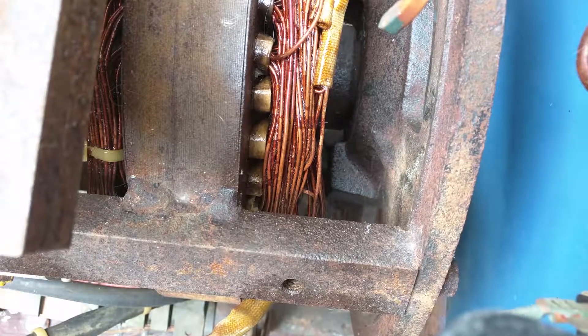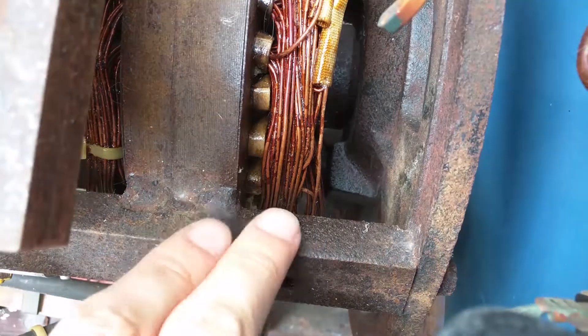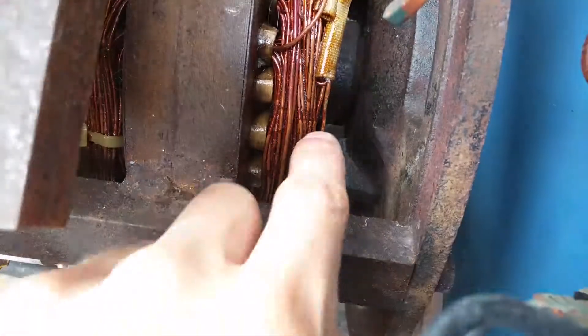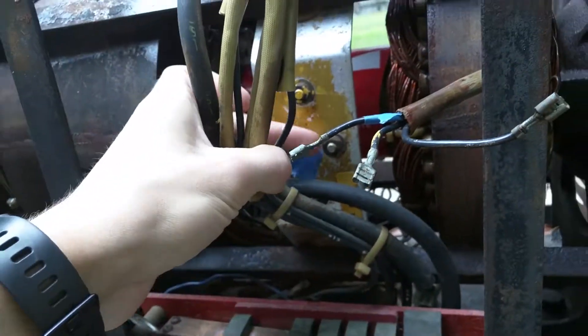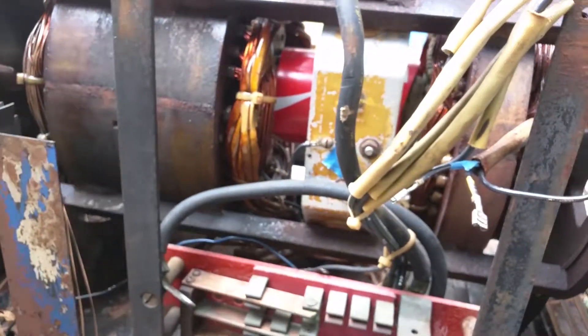So what I've done is cut off the remaining zip ties — there were probably supposed to be 40, started with five — then started pulling and picking the windings apart. And believe it or not, I actually got the resistance to come back up to where it's supposed to be. All I did was, like I said, just see where that one's loose, pull them apart, and hit them with a bunch of clear coat. These are the wires coming from that winding. There are three poles; they go to the three diodes here.